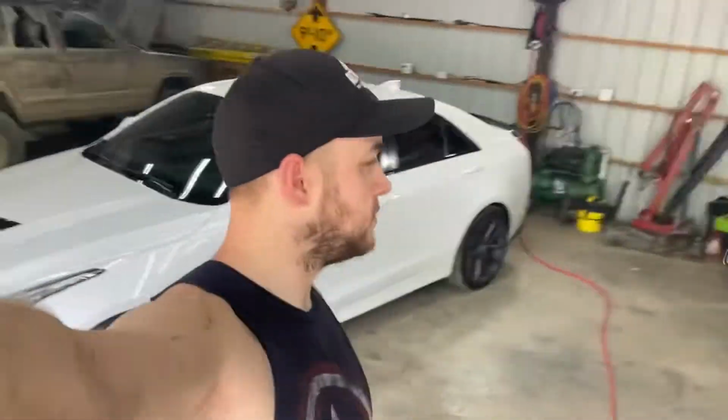Guys, we got the motor pulled. It's set off to the side right now, so now we can start taking off all the additional brackets, anything that's left in the engine bay, like the motor mount brackets, stuff like that. Set them to the side. Then we can take some metal that we bought at the store. We can start welding in all the holes, just filling in everything. And we're going to shave everything else, all the studs, everything like that. Just basically clean this thing up a whole lot. So we're going to start working on that